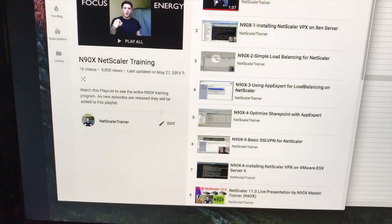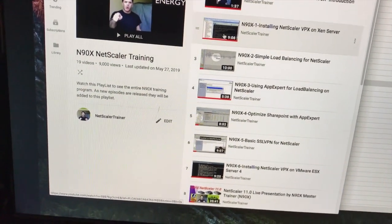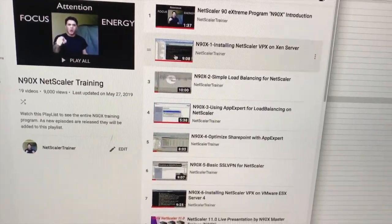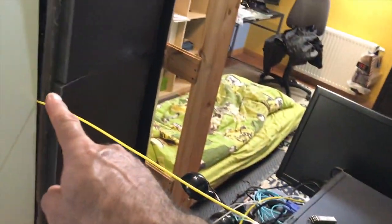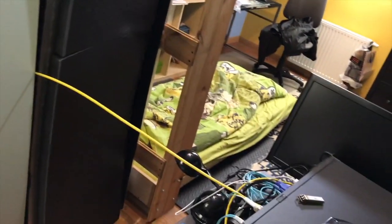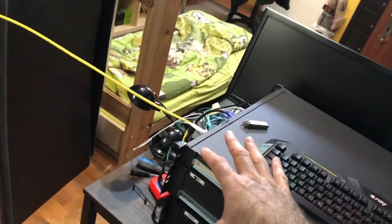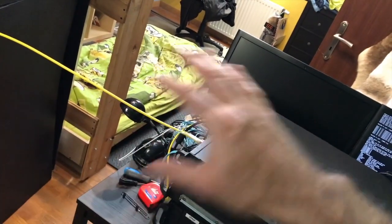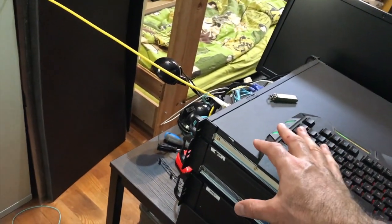Of course, my connection is going to be bottlenecked, because it's going from a 10 gigabit connection to the switch, and then it's going 1 gigabit to my infrastructure and out to my ISP. But the idea for this is to be able to connect up multiple servers to the switch so that when you're going server to server, you'll be utilizing the 10 gigabit bandwidth. And that's really the cool thing about it.